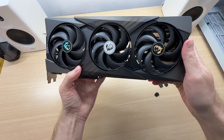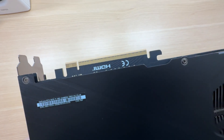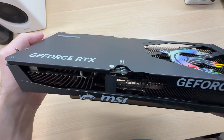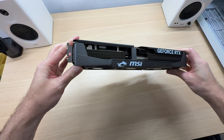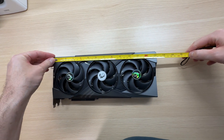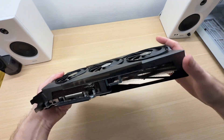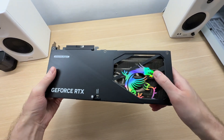That's great. Here's the PCIe slot with the new pattern. This card has two modes — silent and gaming — which means it comes with a dual BIOS, which is always nice to have. In terms of size, this card is roughly two and a half slots thick, 336mm long, and 140mm tall. The PCB is quite short — it ends right there, which enabled MSI to create a massive cutout on the back of the card, allowing air to pass through and increasing the heatsink's cooling capabilities.